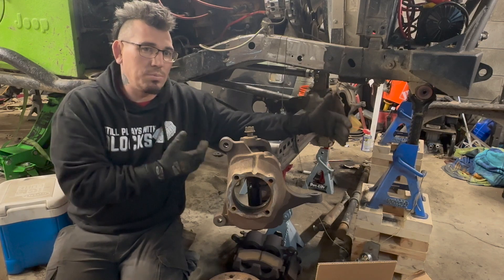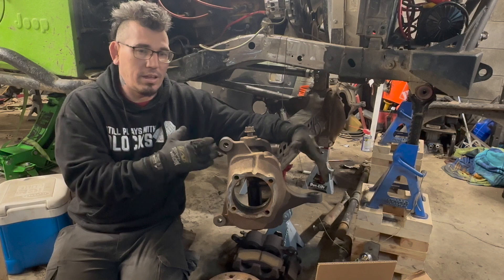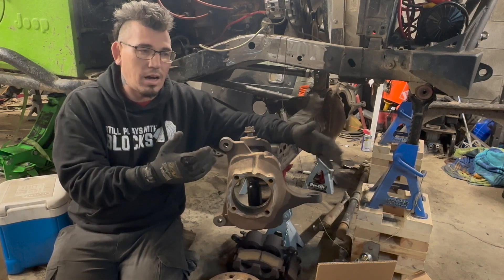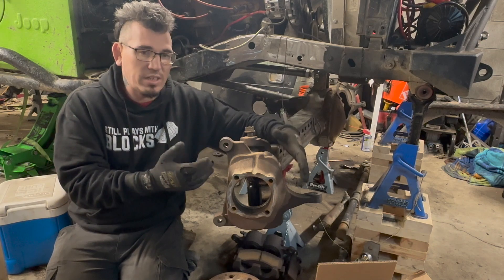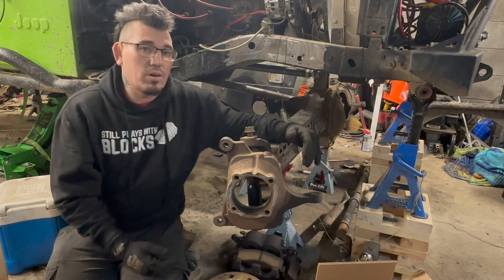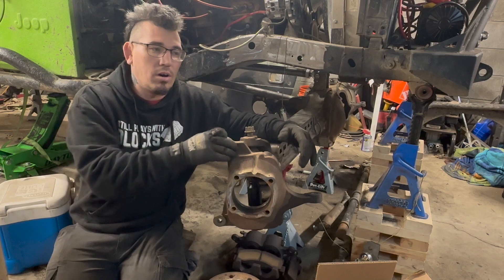With the Jeep, it uses a four and a half inch arm. So if I were to hook everything up like that, I would lose steering — my wheels would not go lock to lock. The way to fix that is to move the drag link back to the four and a half inch sweep that you have coming off the gearbox, or make a longer arm.